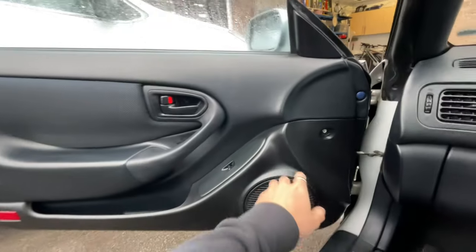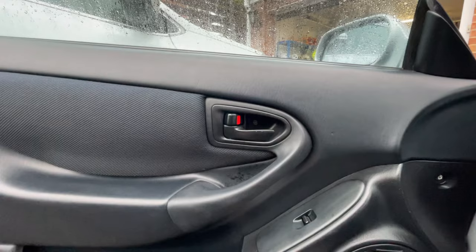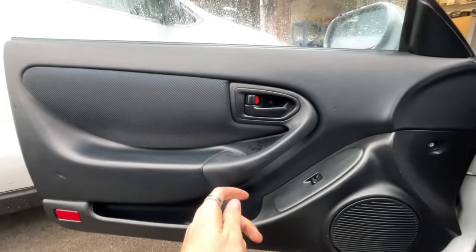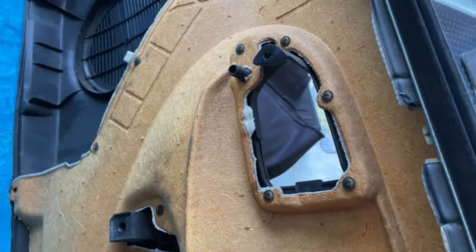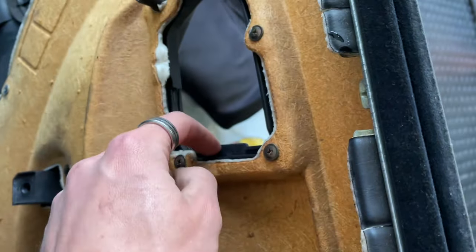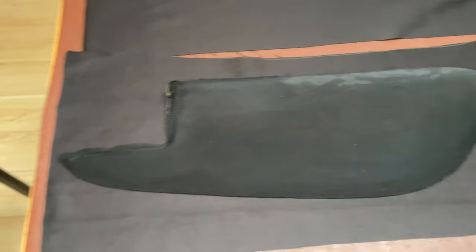The sound system is not a priority and I'm happy with how it is - it's not the best but it does the job. I'm just going to take this one off now. There are a couple of different screws - there's one behind there, a couple behind the door lever. Both door cards are off now. This is the fabric that was originally on it - you can see it's a bit stained and it's actually coming off. It's got this little wooden piece, I think it's just insulation or something. Hopefully I can take the door apart and get these individual pieces off, then re-glue it.